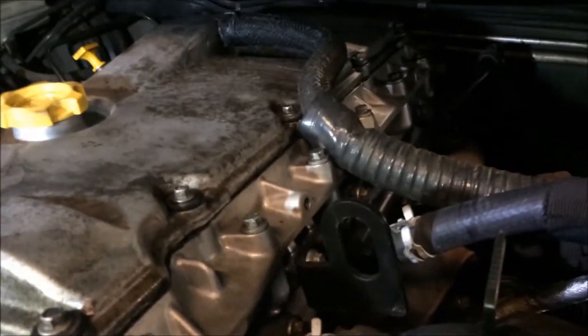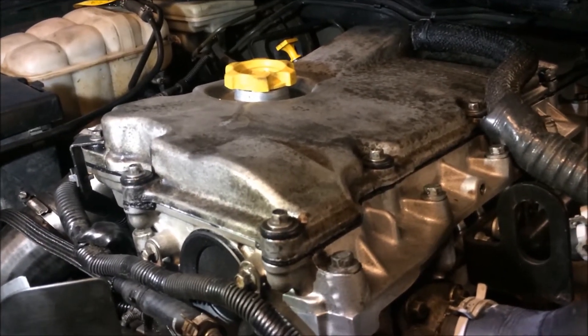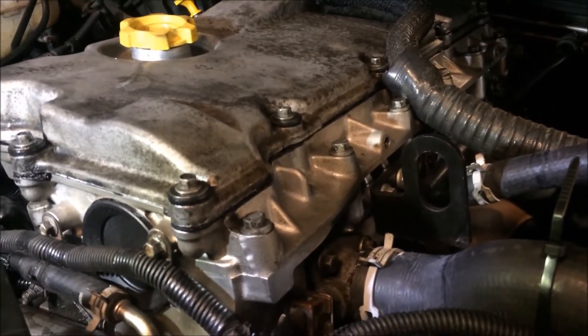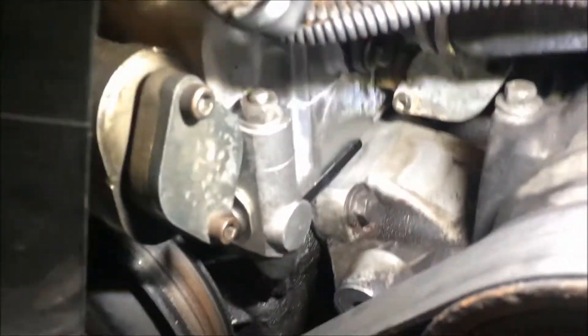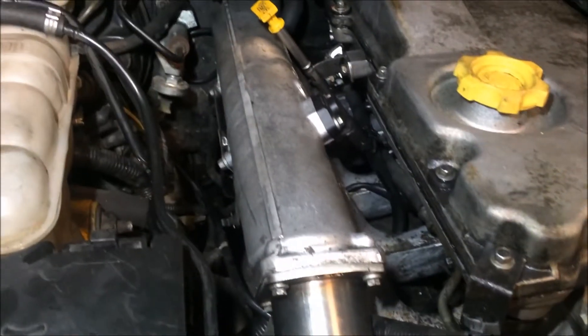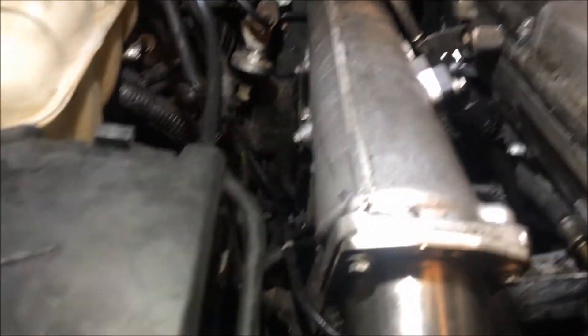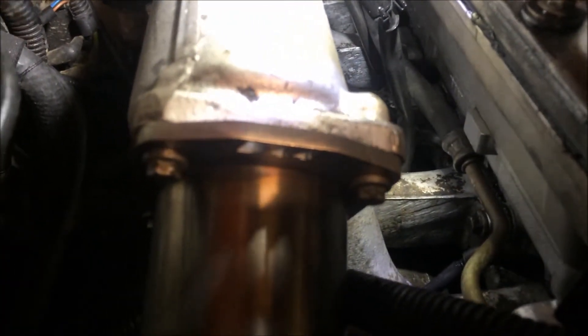Put it back, put the new pipe on, put the new thermostat on, it's had a new rad cap. Rocker cover got sealed up, and made sure the plugs on the head had gasket goo on them, so they all sealed nice. I wanted to put it back together clean — cleaned the intake manifold, the plenum out, made sure it was mint, even made sure the ports were clean enough.